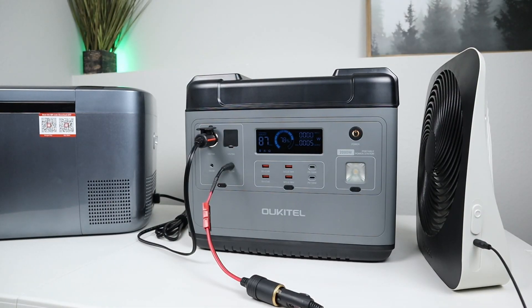Okay guys, it's the next morning. I'm pretty surprised here. The fan is still running, but the 12 volt compressor fridge is shut off. So it looks like the 12 volt cigarette plug and the barrel connectors are separate from each other, even though they have the same power button, because the fan stayed running overnight but the fridge shut off. Pretty disappointing results — I thought if we have a consistent load on the DC output it wouldn't shut off.